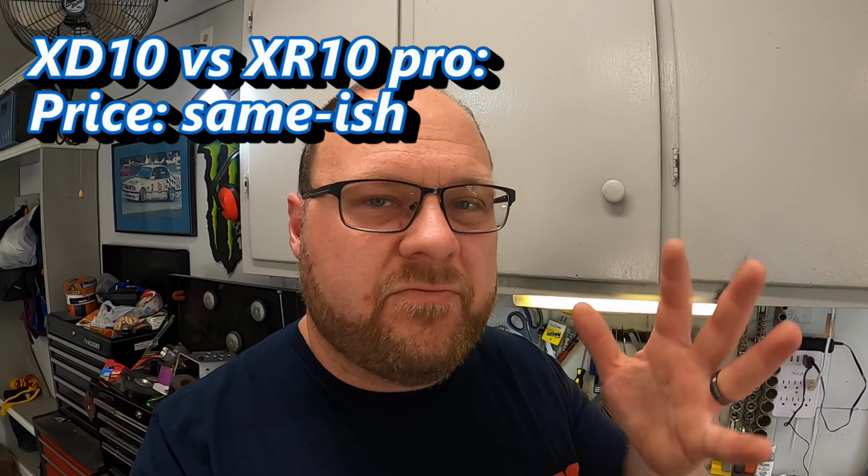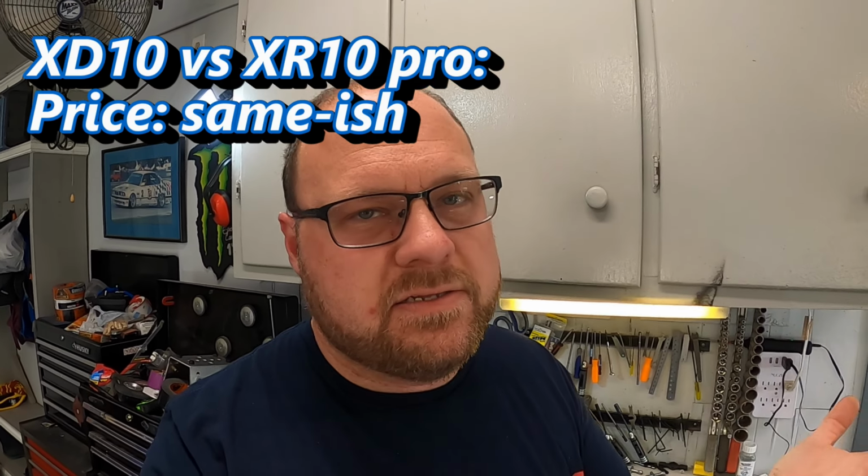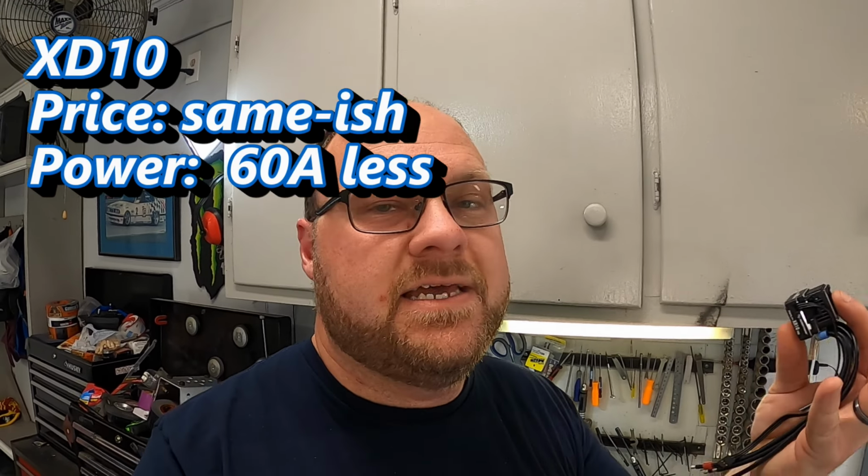Now many of you may immediately ask, whoa Troy, wait, Hobbywing makes a drift specific ESC. It's the XD10 instead of the XR10. Why didn't I get that one instead? There's a $5 difference in price, so basically they're the exact same price. The XR10 Pro actually comes with significantly more power. Again, this is a 160 amp ESC, whereas the XD10 is 100. Do I need that extra power? Not really, but I'd rather have it than not have it, at the end of the day, especially when paying the same price.